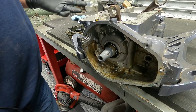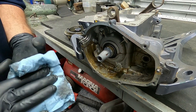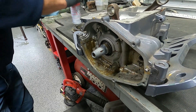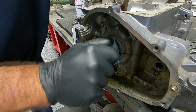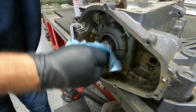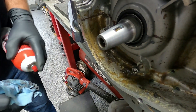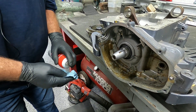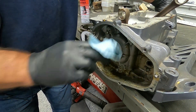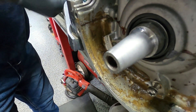I've been lapping away, and now I'm going to take a little brake cleaner and clean it off. I know I picked one of the worst-looking crankshafts in the shed, but that's okay. You can see it's all sanded very clean and very even now. I'm going to wipe inside the flywheel as well.